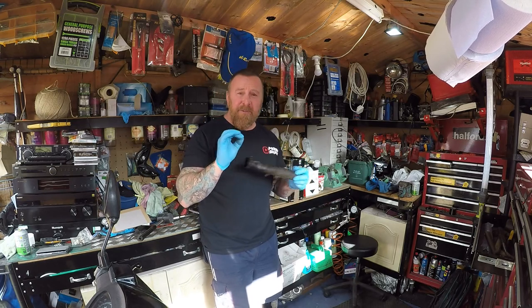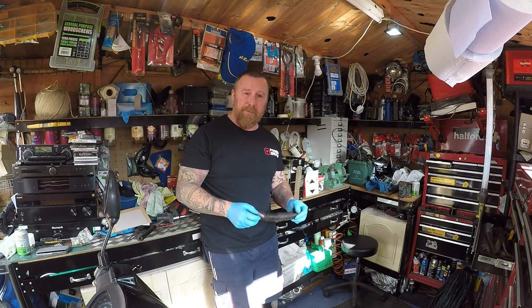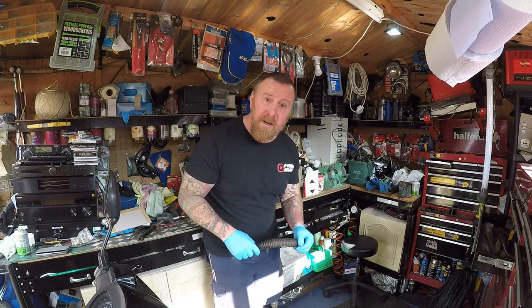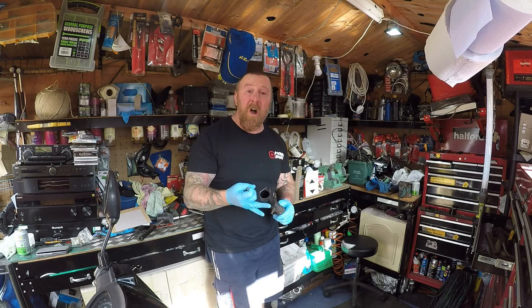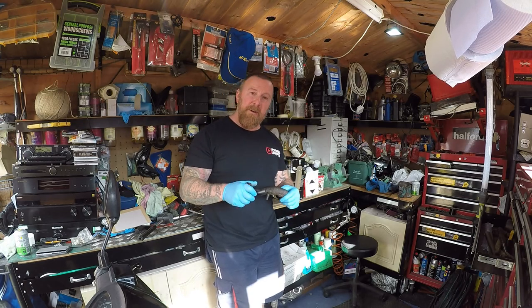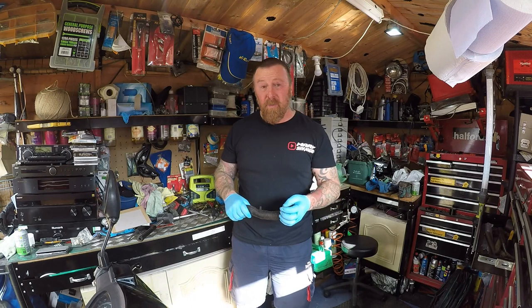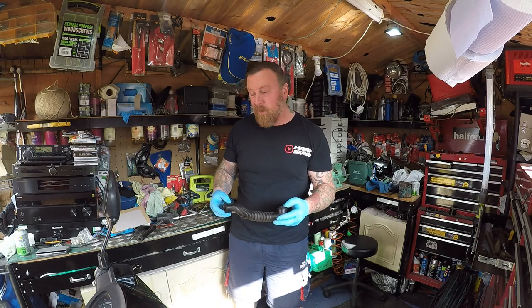Remember: if you've got a running bike and you mess around with it and then it's no longer running — put it back. Don't put big bore kits on. People put 70cc kits on these, 80cc kits, and 150cc ones on the 100cc — it doesn't last. Unless you're willing to upgrade the plug to one heat range, but then you've also got to tune, get a new carburettor — a bigger carburettor, 19 or 20mm if you can. There are so many things: air filter, and if it's 2T, more oil. Rather keep it at 50, 100, or 125 and mess around within that.